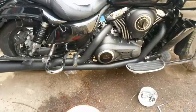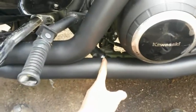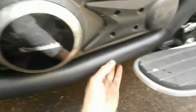I'll be back. Okay, we all know the pain of heat shields. These are no different, but the rear jug, there's a worm drive here, and a third one near the top. The front jug is a worm drive here, a worm drive here. Right here is the T-clamp for the two joining exhausts. That's the last thing that gets tightened according to the instructions. There's another worm drive here, and then finally a worm drive up top.